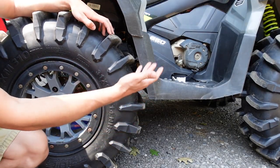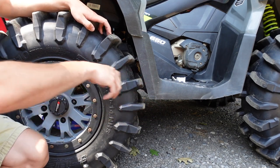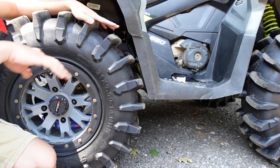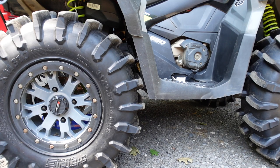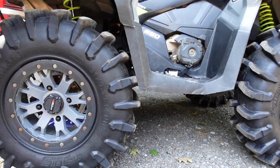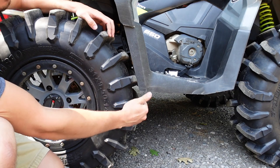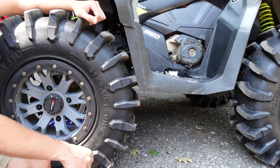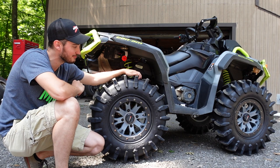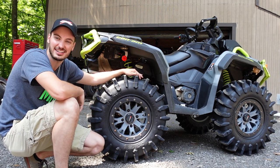The problem is she's riding a little close to my footwell. I can barely fit — I can't even fit my finger between the footwell and the tire right now, which is not good. Especially since this is trailing arm suspension, which means that once the rear end is drooping, the rear end actually pulls forward, and I have a lot of rubbing. Obviously I don't want to destroy my brand new tires. I could chop the footwell, but it also rubs on the inside, and honestly I don't want to chop my quad. I like the OEM-ish look — kind of discreet.